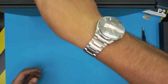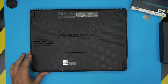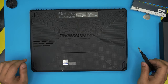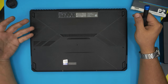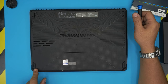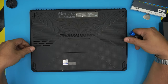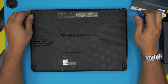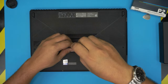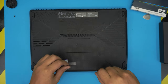Power off the laptop completely, flip it upside down, and on the bottom cover you'll see a bunch of screws. There are two types: short ones in the front row including the one in the middle, and long ones on the sides and back row. Keep them in two separate piles so you don't mix them up.